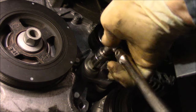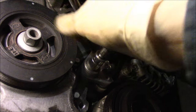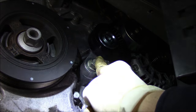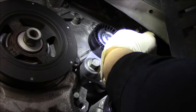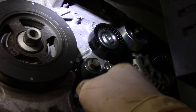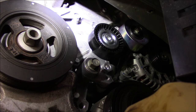We're going to tighten up this bolt here. So now our tensioner is tight and caught and tightened up. The top of the tensioner here is caught. Our idler pulley is tightened up. Next thing we're going to do is come in here, put our belt in, and the last thing we're going to do is pry down on this and reattach our belt. Let me grab the new belt and we're going to continue.